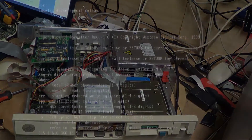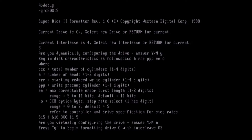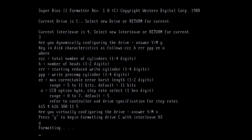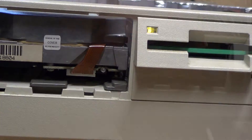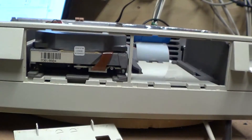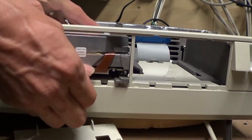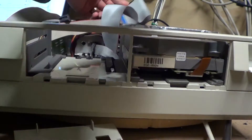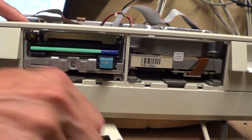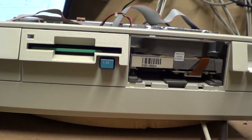I went through the low-level format procedure and that went great — winner, winner, chicken dinner! I prefer the drive to be in the right-hand bay if possible, because it gets slightly better ventilation from the power supply and will cause less heat soak around the electronic components — this drive was running particularly hot. Thankfully I found another set of hard drive cables which were slightly longer, so I flipped them around. You can get a good look at this little clip-in mechanism, which actually isn't half bad.